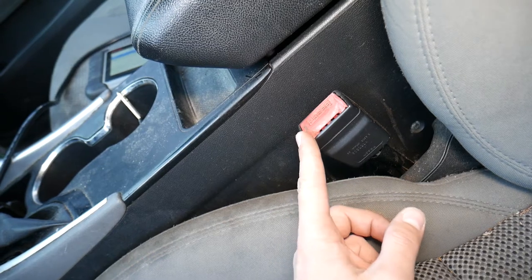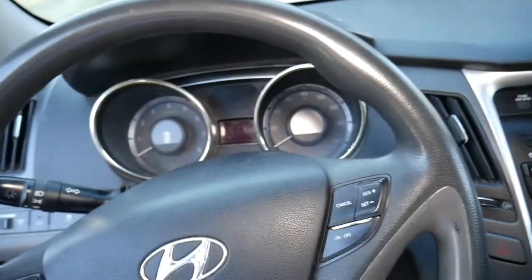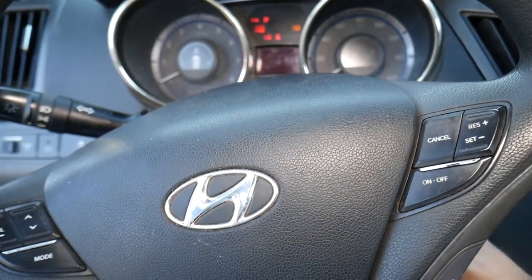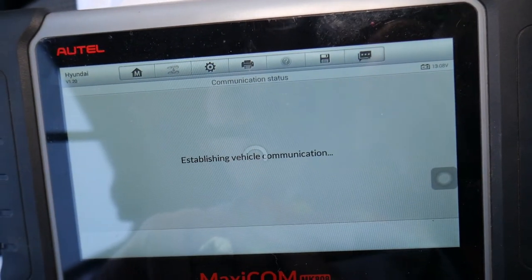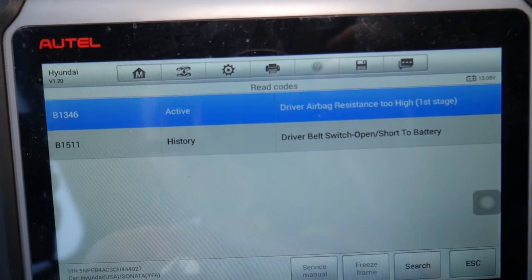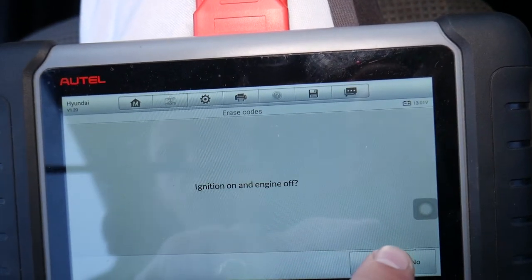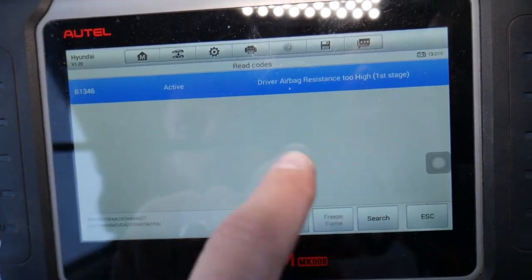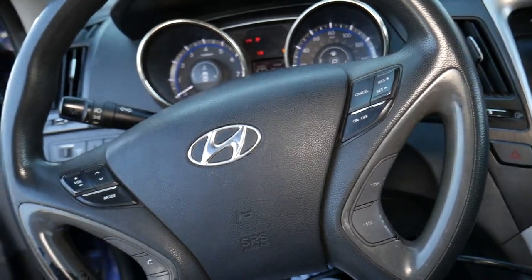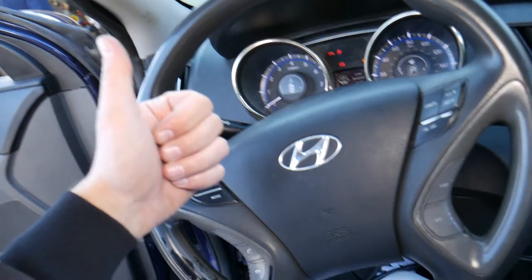pretensioner that's bad. We have a special video that will explain how to test a seatbelt pretensioner, so please check it out. Now we'll reconnect the car battery. The car battery has been reconnected — I'll go ahead and turn the ignition back on. If we come back and read the codes again, if we fixed that code it will say 'history' — perfect. Now I need to erase codes — ignition on — yes, erase codes. Now I can read the code and that code will not be there anymore. We just have the one for the steering wheel. That's how you fix that code on Hyundai and Kia: either a disconnected wire, broken wire, dirty wire, or a bad pretensioner switch. Hopefully the video was helpful — thank you for watching and see you next time.